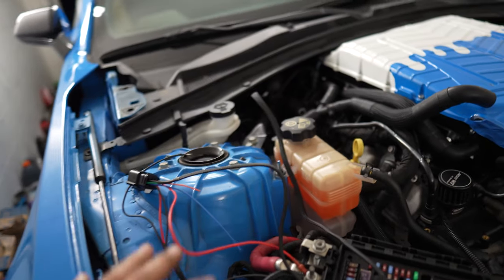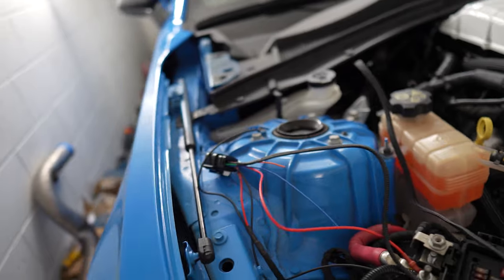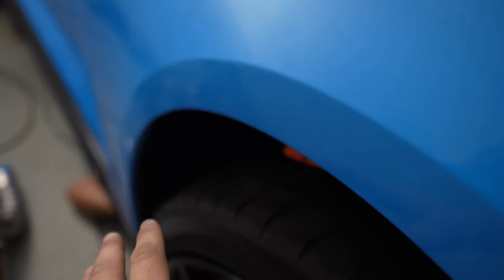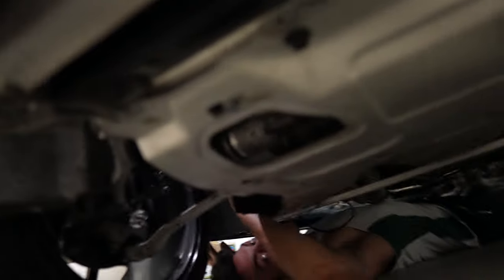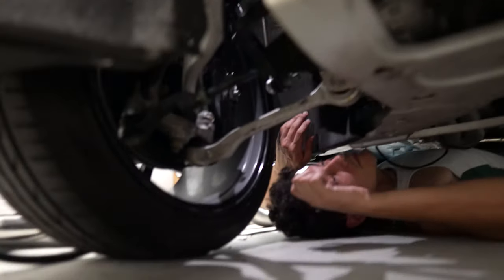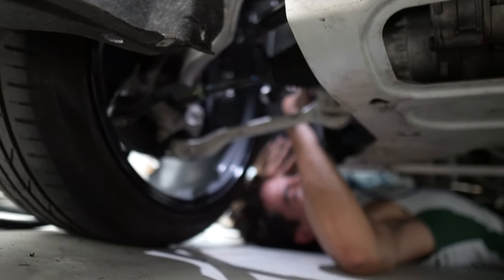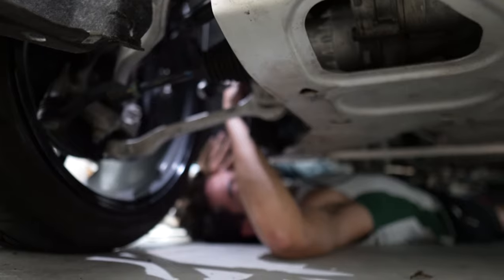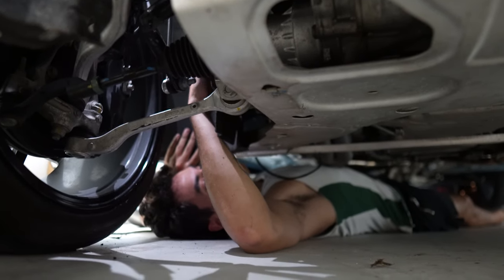You want to take the harness and have the longer end go through the fender liner. You'll need a Torx bit to take out a couple of the screws on that fender liner. It'll run through a specific hole — I'll include a picture of that hole because it's hard to see. Basically you're running it alongside the underside of the passenger side of the car, because that's where the pump actually mounts up.